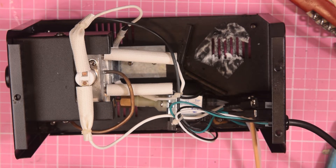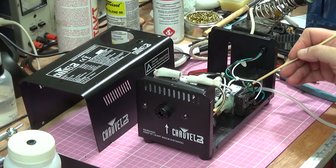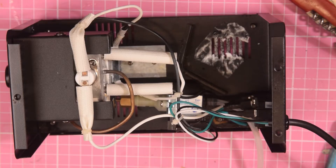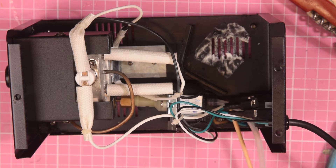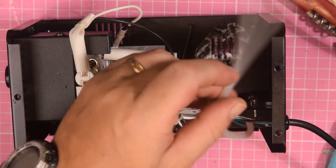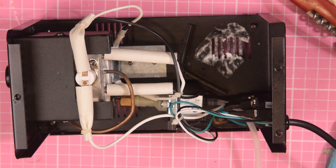When it was fitted, the tools had pinched the edge of this silicon tube. No big deal, nothing major to worry about - it's just one of those things that happens. So what I did was snip a quarter of an inch of tube off and refit it, then push that live terminal down so it doesn't come anywhere near this tube anymore. When this goes back in, there's nothing for it to rub against or sit on.